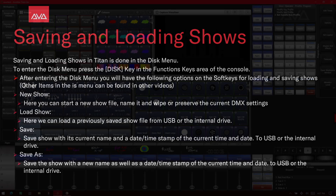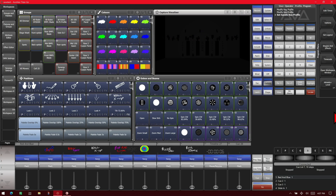So let's take a quick look at that. Here I've got version 15 of Titan on the Titan Go interface. If I wanted to save my current show I'll just press the disk key, then I can click save and choose my internal drive or removable. If I had more than one they would be listed here, and I could give it a different tag instead of a quick save. I click save and we see that it is now saved to our external thumb drive.